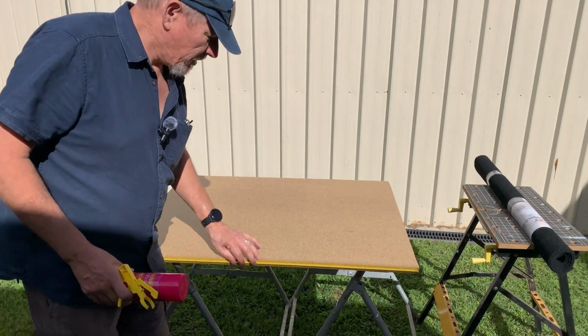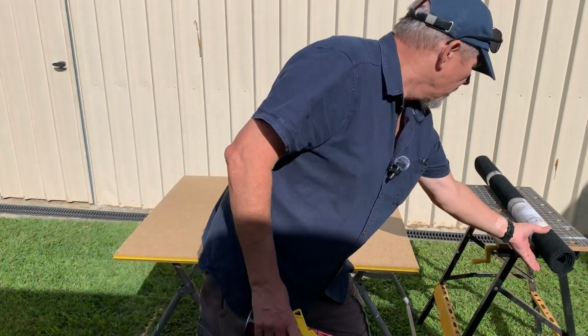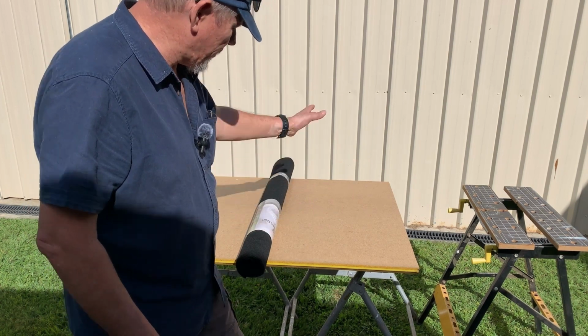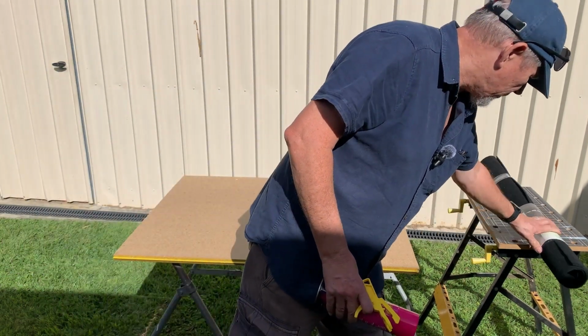So got me a bit of timber. I'm going to take that bit of yellow tongue out of it. And then we're going to essentially glue one of these down. I'll get it all nice and flat and glue it on the sides, then I'll cut the excess off, which I'll take you through in a sec. And then once that's dry, I'll do the other side.